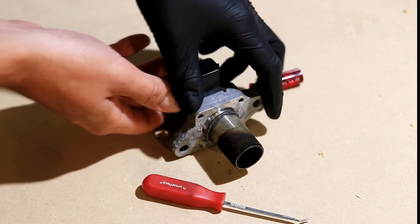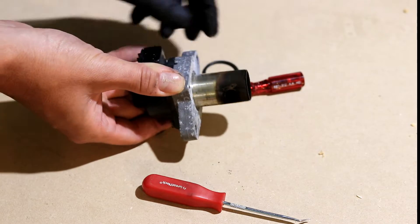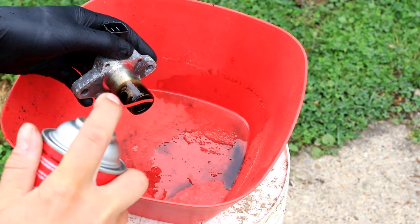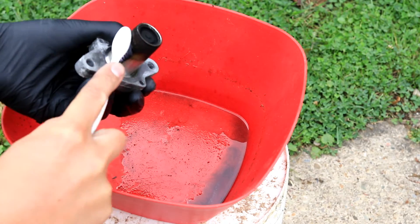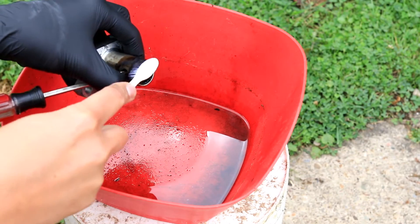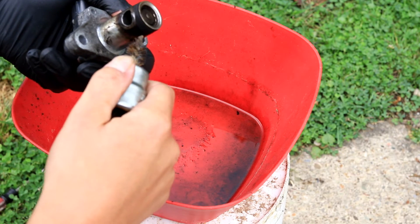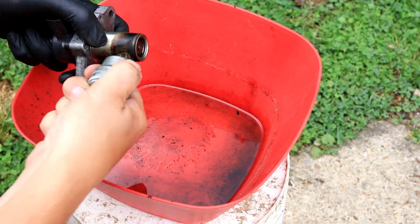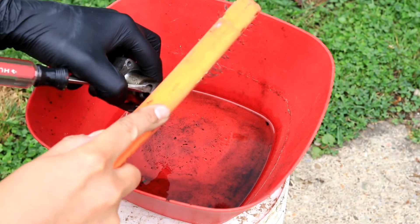Before cleaning it, I'm going to remove the o-ring seal — I don't want any solvents to swell that up. Then I'm using some carb cleaner to remove as much carbon as possible, keeping the cleaner off any plastic parts. I started with a toothbrush to get as much carbon out as I could, which worked reasonably well, but I had to step it up. Using a little battery terminal cleaner wire brush I was able to work inside the EGR valve and make sure any carbon that would restrict movement was worked out. Then I used a standard wire brush to clean the rest of it off.